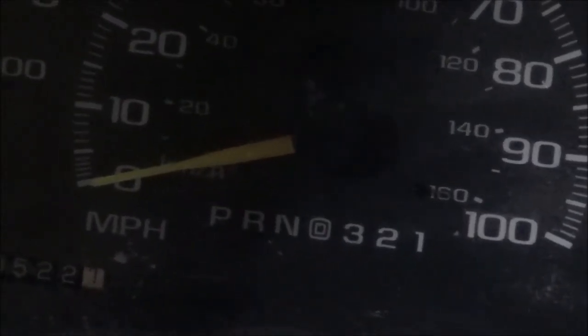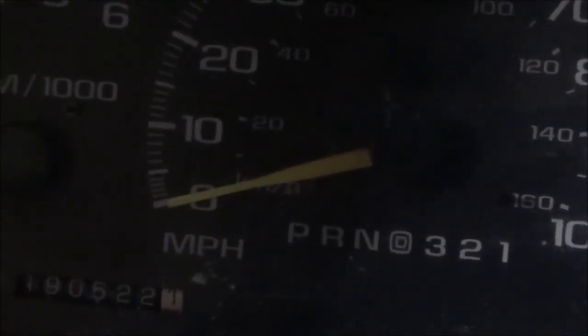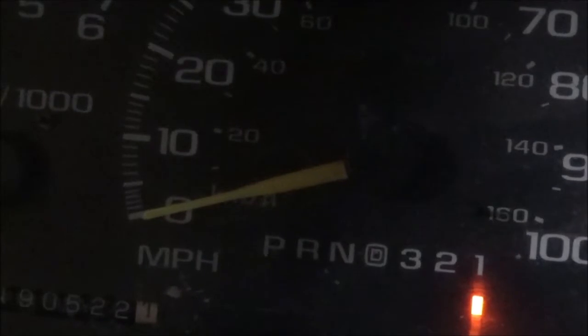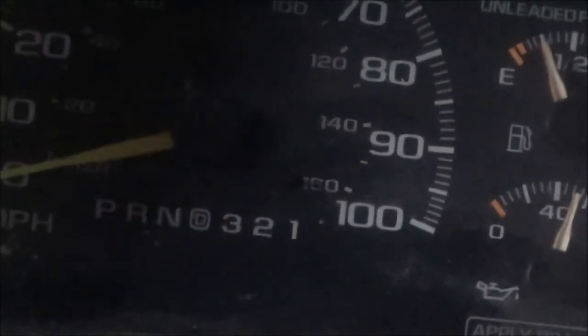You saw that. Okay. Now I'm in reverse, and it's showing reverse. Park doesn't show at all. So I go back to reverse, neutral, drive, 3, 2, and 1, like it shows when I go from left to right. Going back to it, it shut off. I wiggle this here, that's not showing anything. Doesn't do anything by wiggling the gear selector.